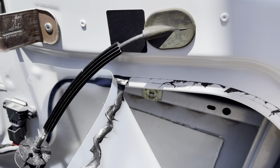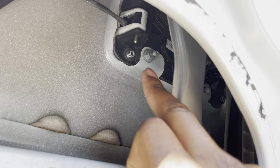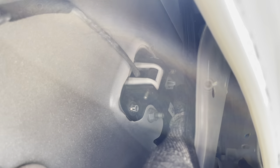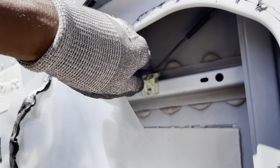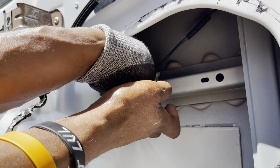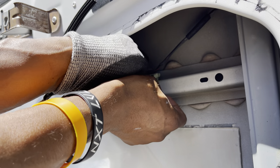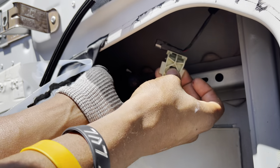Let me show you what I was referring to — you see it? There's one bolt right here attached to the white piece. Look for the ones that are attached to the white — don't disconnect anything else. There's another one right up here. So you've got two in there — just take those out and get on to the next step. Right here is my fingerprint sensor. To take it off, there are two little clips on the inside — one on the bottom, flip that over and get it over the edge, then get the top one over, and it comes off.